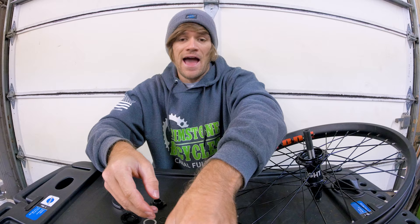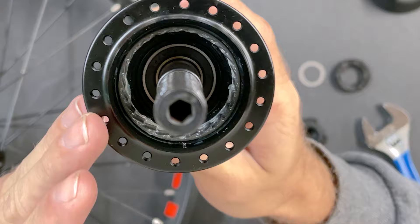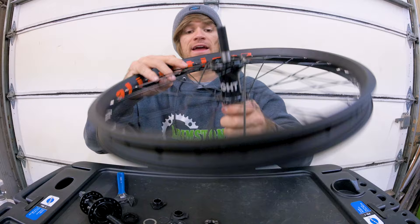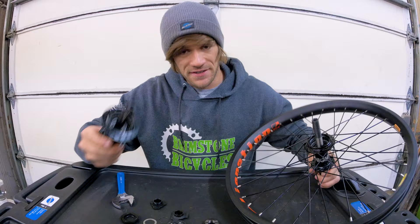Let's take a look at the actual inside of the hub shell of both hubs. The BSD Revolution hub is internally machined for the clutch assembly to fit directly within the hub shell — so the hub shell itself is machined on the inside to fit this thing. Whereas on the Free Night, there's actually a separate piece in there that adapts the clutch assembly to the hub.